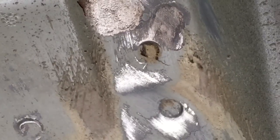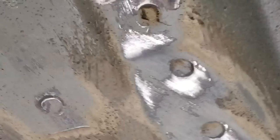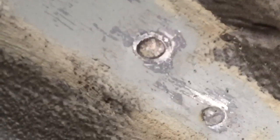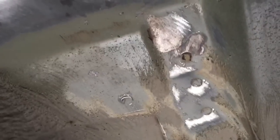And then just taking a little bit off of the chassis legs at the bottom, and we've definitely got some cracks coming out around that one, which we'll need to stop. I think we had a slight bit coming around that spot weld, and I think there was one on the other side there, and that one there, that black jagged line around the edge is suggesting a crack around that spot weld there. These two aren't too bad, this side, because that's straight into the boot.